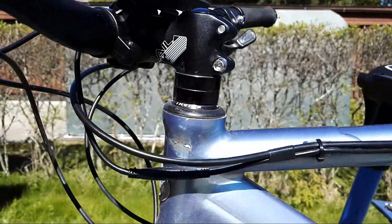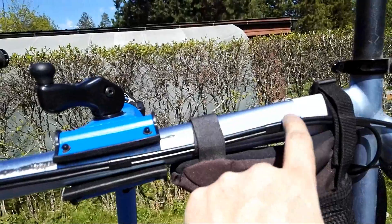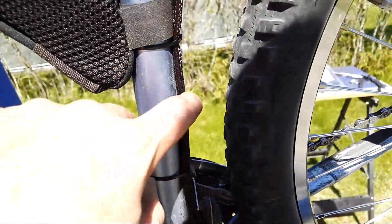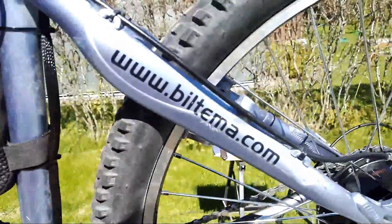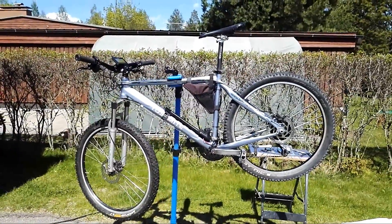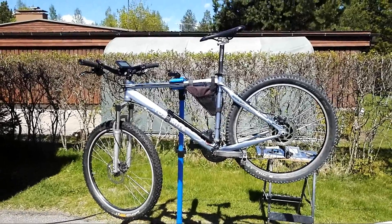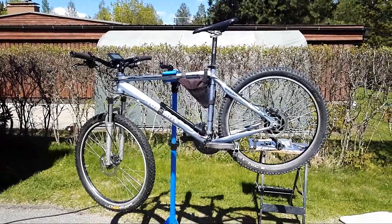The bike is now ready and all wired up. I paired the LCD screen wire with the rear brake cable using electrical tape and fastened it on the rear brake cable mounting points. The battery wires and PAS sensor are routed inside a cable shield, and the motor wire runs along the chain stays. Everything is tucked up in a small frame bag. From a bit farther away it's a pretty clean install — always difficult to hide all the electronics on a normal bike, but I'm pretty happy with the end result. I'm now ready to hand the bike over to my brother for his first test ride.